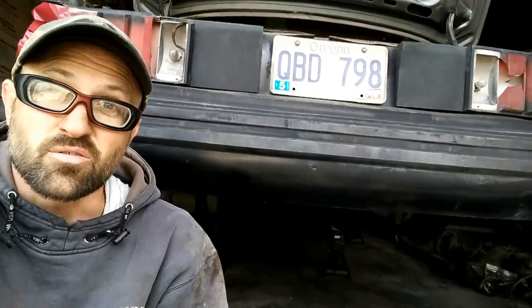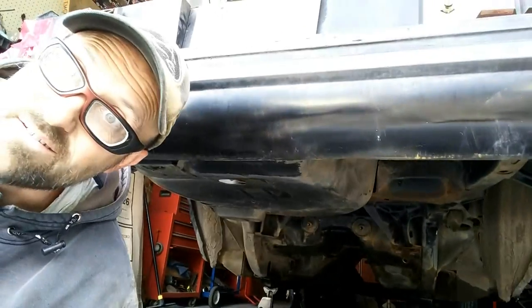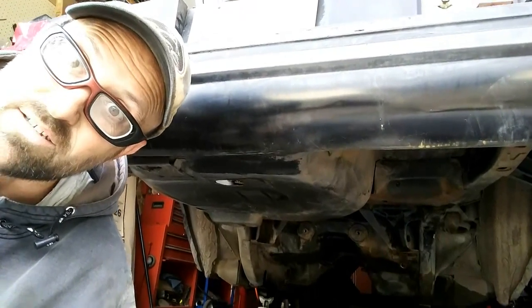With the '92 brought up to the garage and set in place on some jack stands, it's time to get all the other pieces off the '80 and put on the '92. If you look underneath there, there's no axle - it's gone. I put it over on the '92 and you can kind of see, yeah, still a little bit of dirt in there, but I do have some upper reinforcements that I'm going to put in the torque boxes prior to putting the 8.8 back into this.